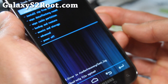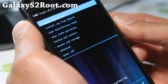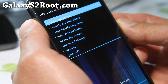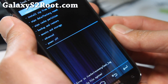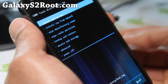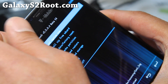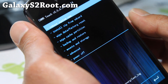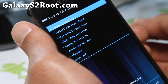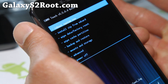There we go — that's what it looks like. Some of the new ROMs, for some reason, won't flash correctly if you use just the regular version. But this one should work with everything. If you're having trouble flashing ROMs, try updating the Clockwork Mod Recovery on your T-Mobile Galaxy S2, SGH-T989 — any SGH-T989 will work.